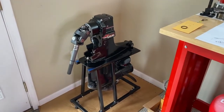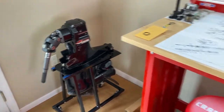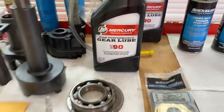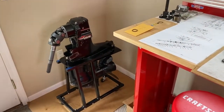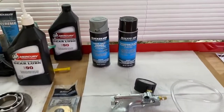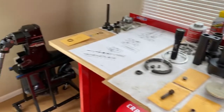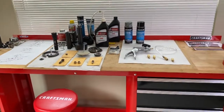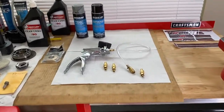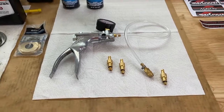At this point the outdrive is repositioned back. Next step — we are going to fill this freshly rebuilt outdrive with gear lube: Mercury High Performance Gear Lube SAE 90. We'll post video links below on rebuilding, repainting the propeller, and more — including a new set of decals we just received. DIYers, we hope the video helped. Click that thumbs up icon, like the video, subscribe to the channel, and ring your YouTube bell. Thanks again for watching. We highly recommend this pressure test hand pump kit — it is awesome.